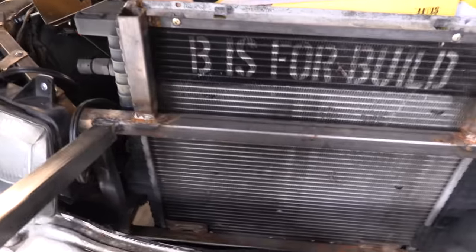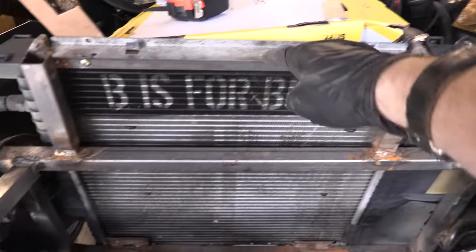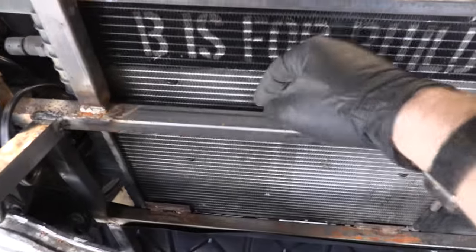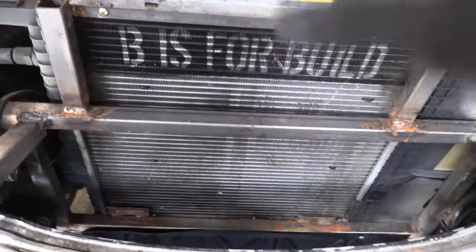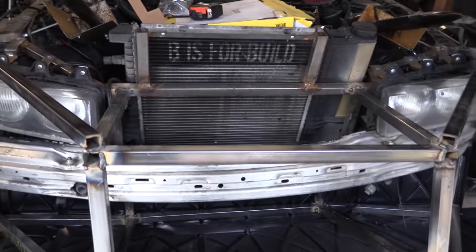The radiator, some of you guys think we're gonna block the radiator. We are gonna partially block the radiator. So I'll put a piece of plastic right here across it so we don't put foam in the radiator. That'll go across here. Then we'll build a little fin on top of here that sticks out that will shovel air in and down and through this crack right here. The fan will still be able to draw plenty of air through there. So that's our hope, is that we won't overheat.